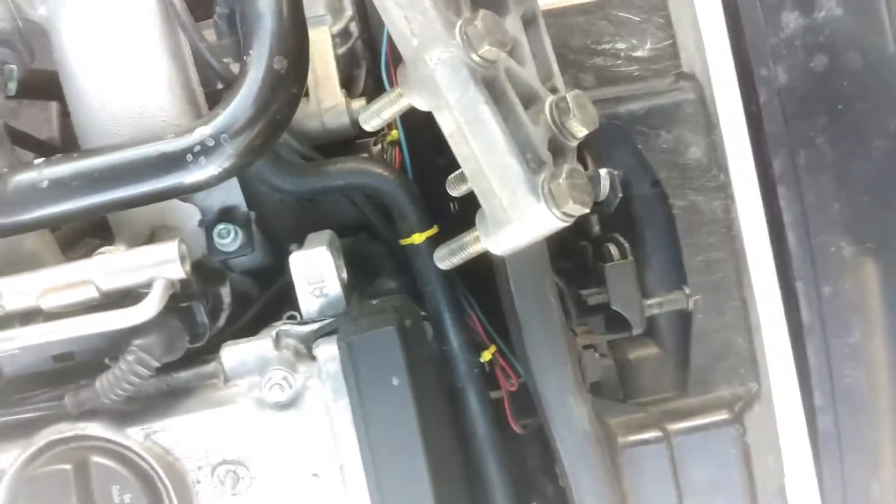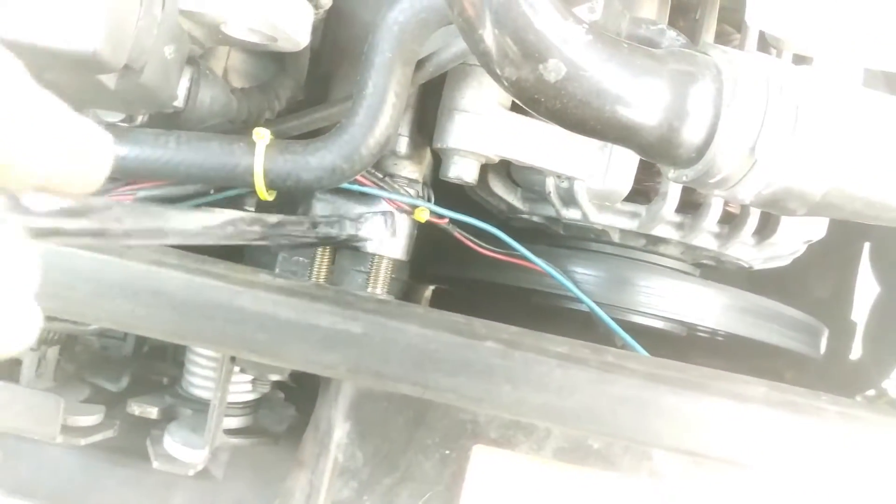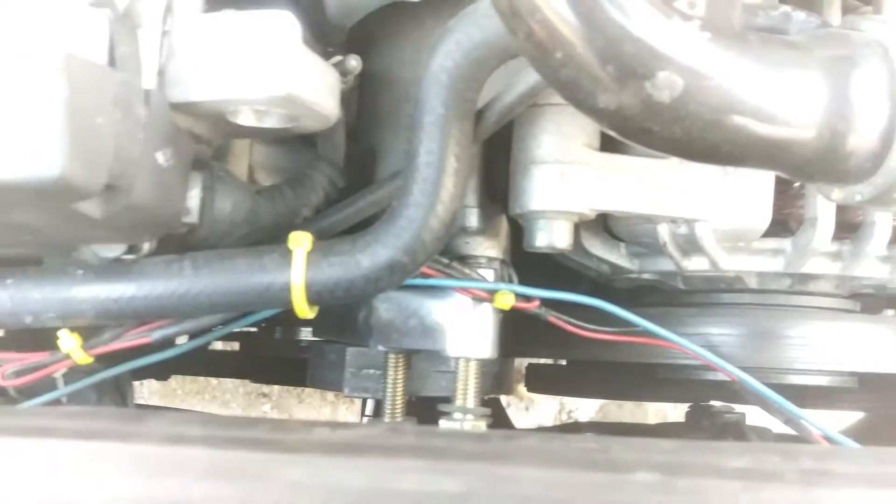Didn't have to do anything — just slowly got it out and now I'm slowly putting the new one back in. The belt is still in place and I'll double-check as I go. You're going to have to be very creative. Once I got this bolt in, the whole thing was still wobbling, so I pressed the belt in and it hopped into place on the pulley end so it sits tight. It's done with patience — got the belt aligned and now I'll tighten everything up.